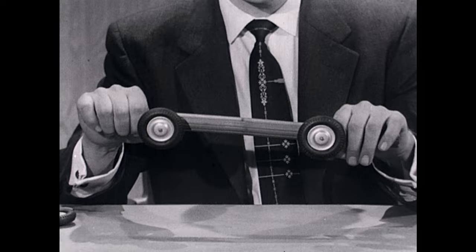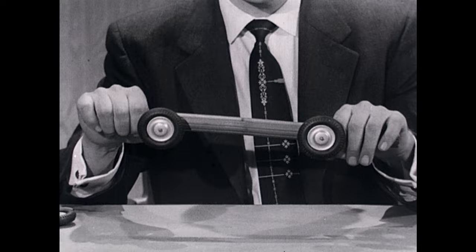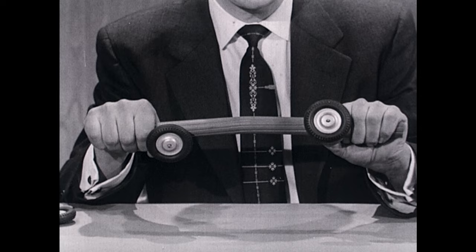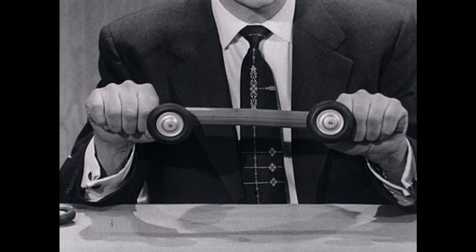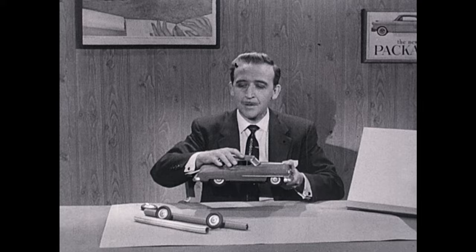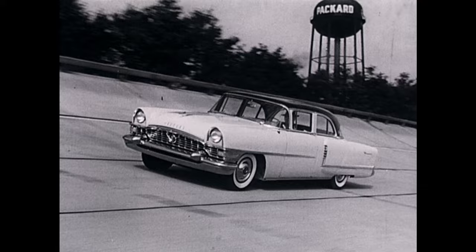After years of hard work, Packard engineers have connected front and rear wheels on each side to one torsion bar spring. So the bar spring flexes when the front end goes over a bump, and its elastic action makes the rear of the frame rise at the same instant. The wheels work as a team to keep the frame level. The result is an unbelievably level ride — instead of pitching, there is a smooth floating action, with the passenger compartment always remaining level. You ride straight up instead of tilting back and forth.